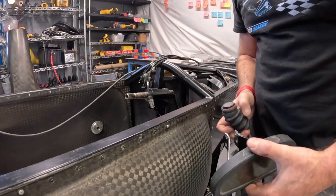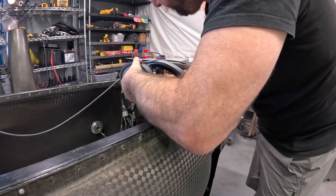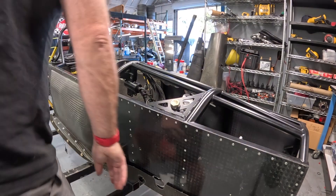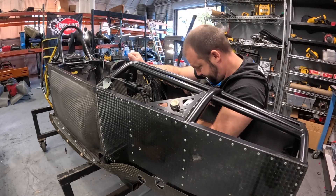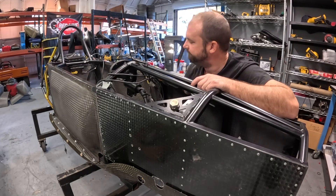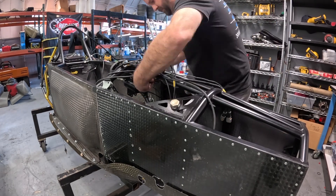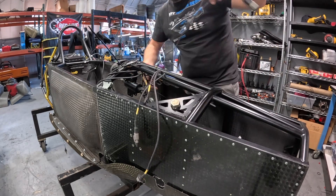We're going to install the Motec dash in the harness now. Even though it's an ADL3, which is an older model, it's a very capable dash. Some of the original sensors are not going to be on the car because we're just going to take over and have the information pushed via the CAN bus from the ECU. But this harness still has a lot of work to do - it will cover all four shock pots as well as all four corner speed sensors. We also have a front and rear brake pressure, a steering angle sensor, and it has to communicate with a G-load sensor and a GPS sensor. We also have some connections to be made to the steering wheel so I can press buttons to acknowledge systems on my dash.